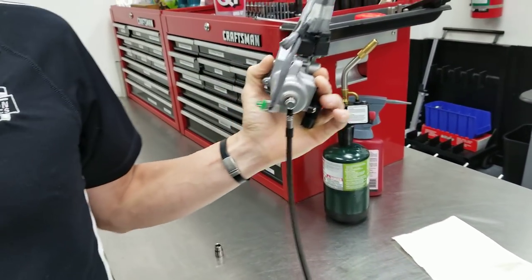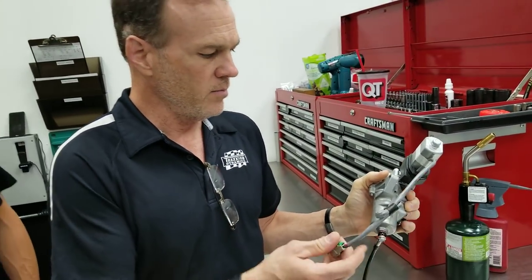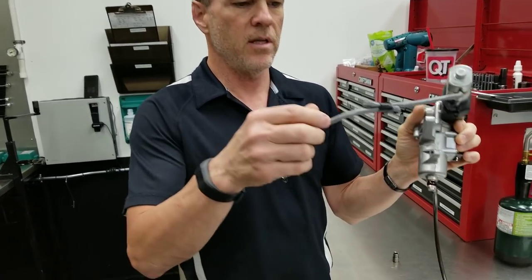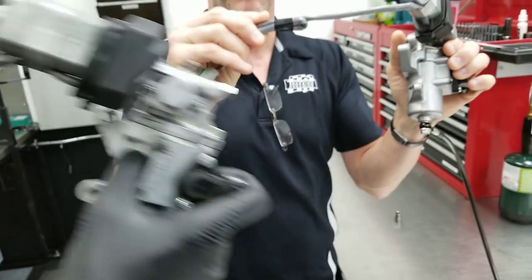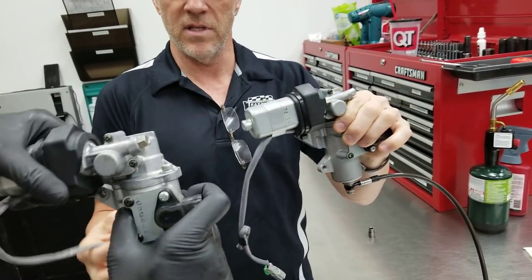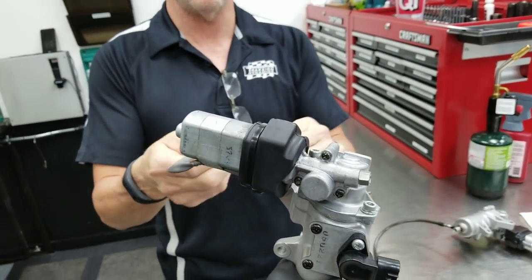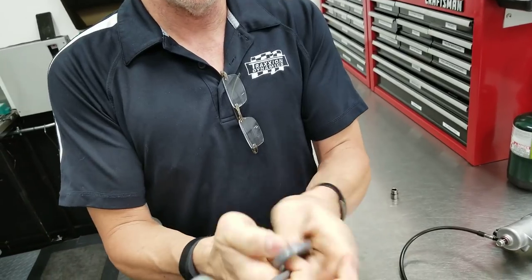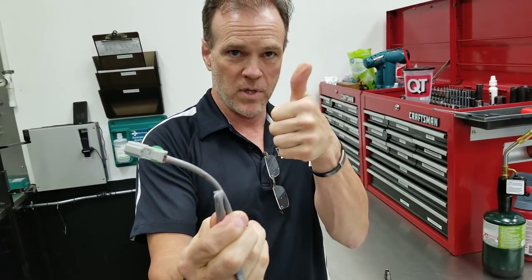One of the funny things is on a 2018 Honda Goldwing, Honda didn't bother re-specifying this to have an appropriate length wiring harness on it. So they literally just folded the wire up and put a piece of electrical tape on it. So this is one from a 2001-17. The only modification you need to make to put it on a 2018 is you bend the wire 3 times and put a piece of electrical tape on it, and now you have your whole new updated system for your 2018 bike.